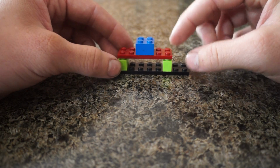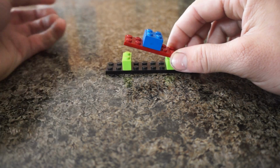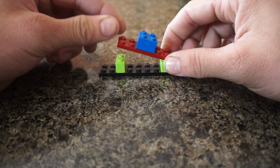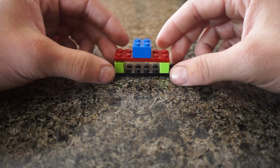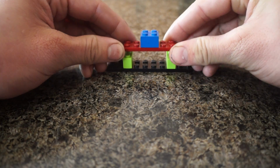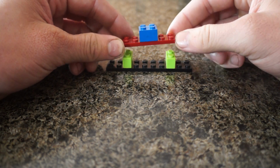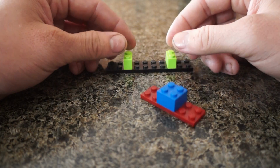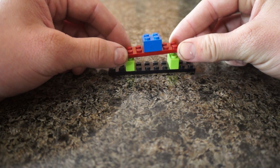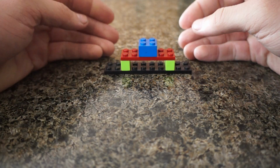But once that side is on, we'll stick the nut up top here and the nut on the bottom, and then we'll pivot off of that mount for the other side, pull that mount off, put the new mount on, and drop it back down again. So you absolutely could unbolt both all the way and then just lift the motor straight up like that, but I found that's a trickier way to do it. Either way, the engine might try and fight you coming back on. So you're just going to have to slowly lower it and work it into the position that you need it to be, and then bolt it all together, and then it'll be good.